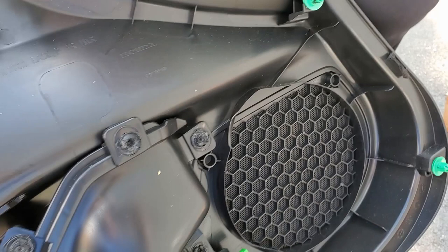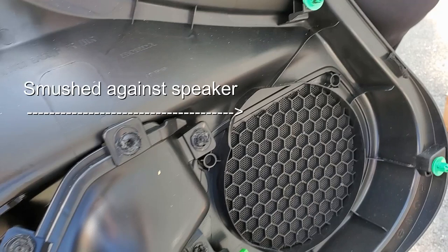One other thing that's very important to show — you'll see these are the rings inside the front doors. The front doors have little rings that stick out towards the speaker. What's very important to see is that they're bent, because they're used to a particular size of speaker and everything's very tightly put together in there. These were pushing against the speaker and bending, which was influencing the sound and can cause rattles. So what you want to do is take a Dremel and Dremel that ring out completely. It's just a little piece of plastic — cut down into it and Dremel around it and it'll come out. You'll never need it anymore.